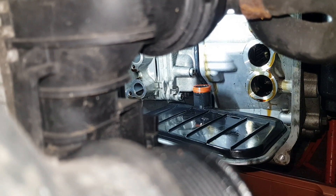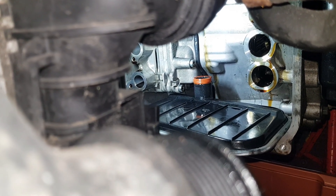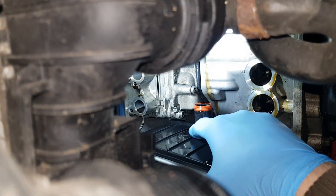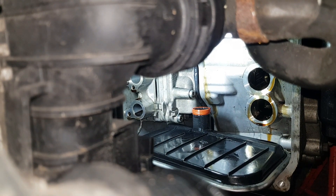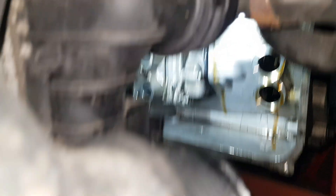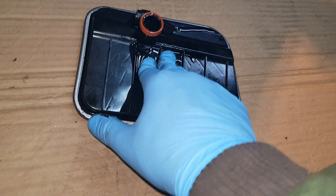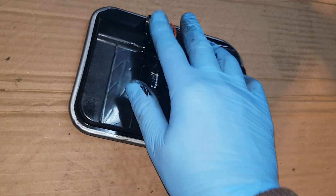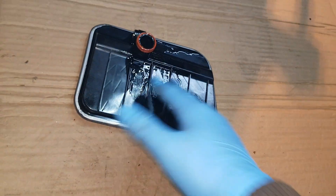There is a little bit of flex in it, but you don't even know how tense it is here. Maybe I'll heat the filter up so that it's more flexible - let's try that. I'll use my heat gun to heat the filter up around so that it gives a little bit more flex to the plastic, and maybe I'll be able to just squash it far enough to basically squash that down without cracking and just slide it in.